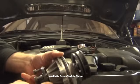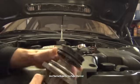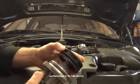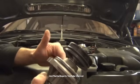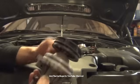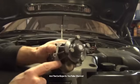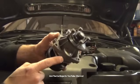through the engine. A couple things that can fail, especially on some earlier pumps: the impeller would separate and then you would get no coolant flow through the engine. You can get a leak from this gasket right here, or you can get an internal leak which will show up at this little area here. There's a little weep hole right on the side over here, and you can get coolant running out of that